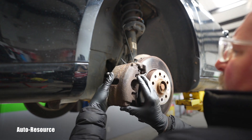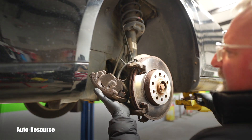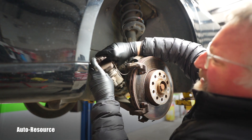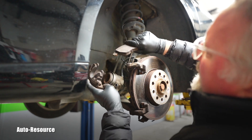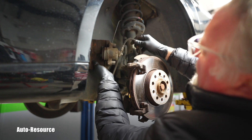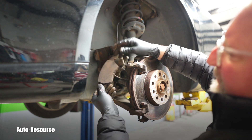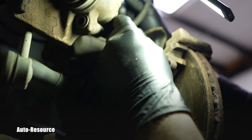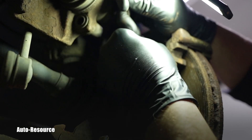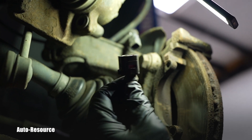It's actually coming with the outer brake pad and the inner pad. I will take it away and carefully remove the inner pad. I will hang the caliper so I am not damaging the brake line. Now I have that inner pad with the wire which indicates the wear. That should slide down — and there it goes.